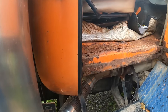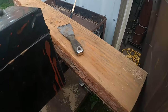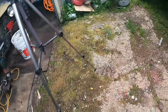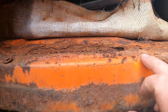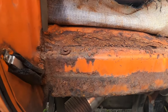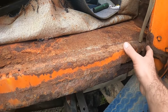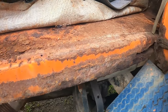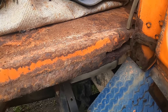I've been wanting to address this for a while and get the door jamb fixed because that just looks bad when you open the door. This is a cool truck and I'd like to preserve it and keep it going for at least my lifetime. What I have here is just a metal plate off a furnace I used to have, and it's actually got the perfect lip on the bottom. This lip will go underneath on this lip, and then I'll splice it in somewhere up here. So I'm going to start by cutting this old crap out, then cutting into the new piece of metal and splicing it in. I'm going to put a lot of that on time-lapse so you don't have to listen to me babble for three hours. Let's put this camera up on the tripod and get started.